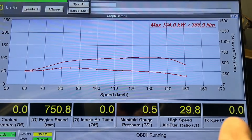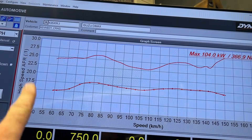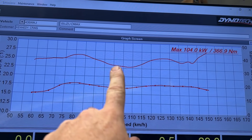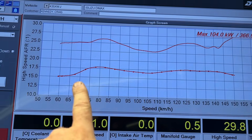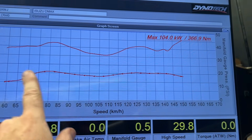Let's bring up the AFR on one side and the boost on the other. So you can see our AFR is the solid line - we're starting at 25s and then it comes down to 22s and goes back to 25s. Our boost started around that 10-11 pound mark and sat around a 20 pound mark all the way through. So what we'll do now is get the laptop out, have a bit of a play with the tune, get a little bit more out of it. This still has the DPF in. We'll probably just turn the EGR off so we don't have any contamination coming through. We'll get it run up, see what it does, see what we come out with, and we'll monitor boost and AFR and keep an eye on that. We'll do a couple of runs and check revving's okay.